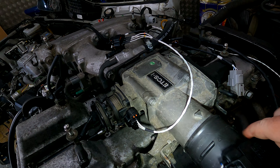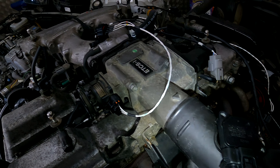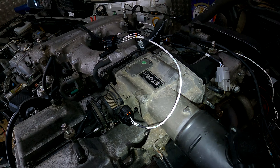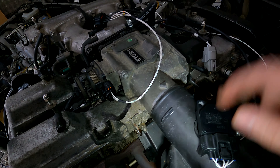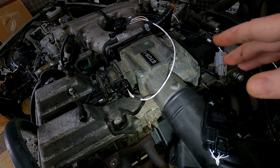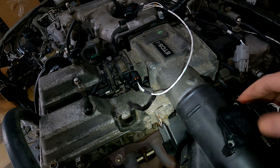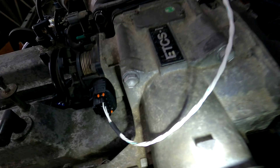That wasn't completely the wrong way around. It'll do exactly the same thing, and this applies for the UZ as well - I'm going to show you on a UZ exactly the same thing when I have my next harness, a 3UZ that's coming up. So that's the one major thing I see - guys putting this the wrong way around. You see how it behaves: it basically tries to start and then it dies. In a JZ's case you can actually completely disconnect the MAF.